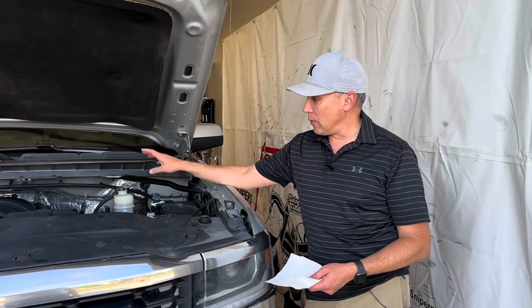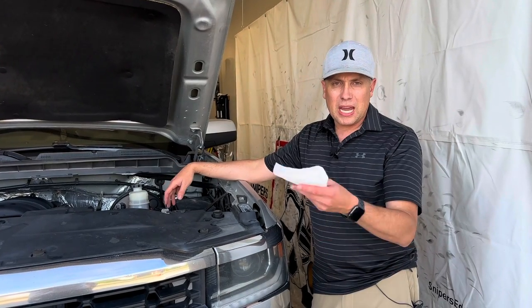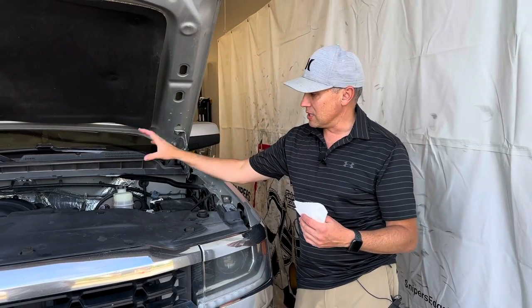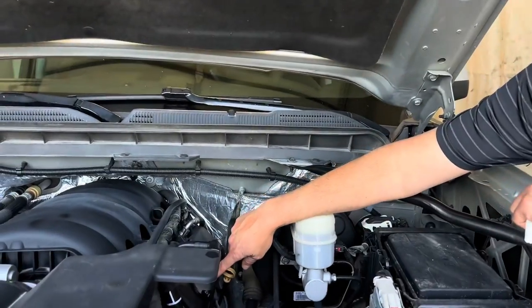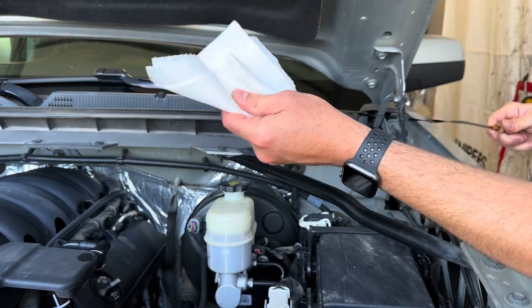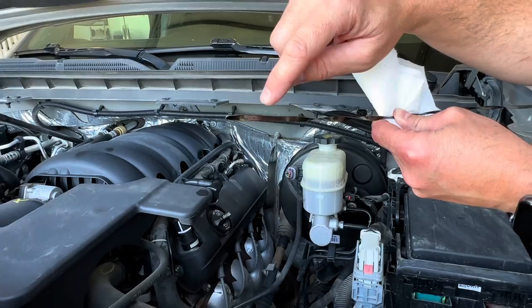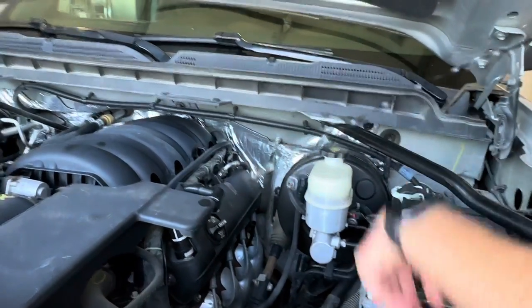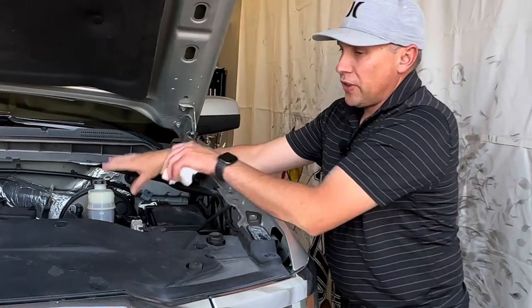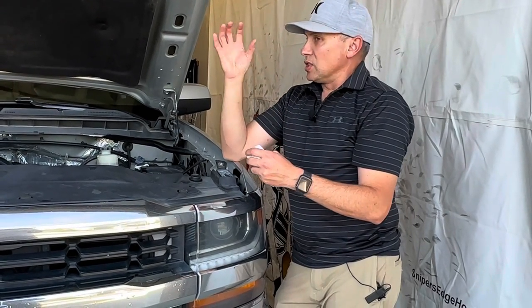So it's the next day. The final step of the oil change is to check the oil level to make sure I'm within the range needed on the dipstick. I'm pretty sure I am because nothing's leaked on the ground and I poured almost eight quarts in. But you want to drive the truck a little bit to get the oil cycled through the engine and filter, then let it sit for 30 minutes and check the oil. Next to the oil fill, this yellow circular handle is the dipstick. Pull it out, wipe it off to remove any residual oil, and make sure the oil is between the two dots — the hash marks. Put it back in and see where it's at. It's right up to that top dot, so it's completely full. One other thing I like to do after a day or two is crawl underneath and check the oil plug and oil filter to make sure there's no oil leaking down, and tighten either if needed.